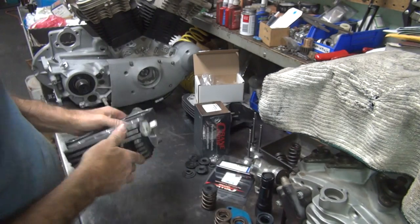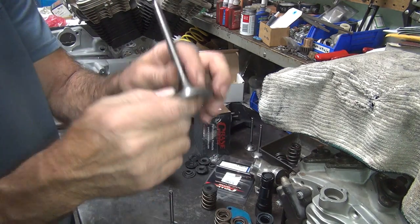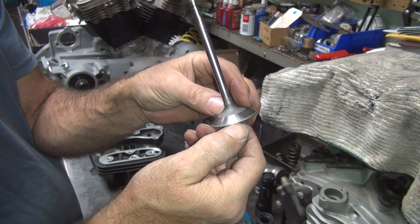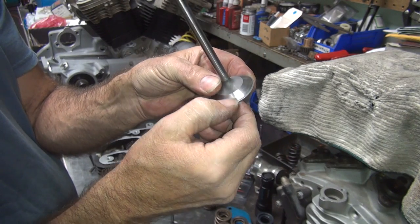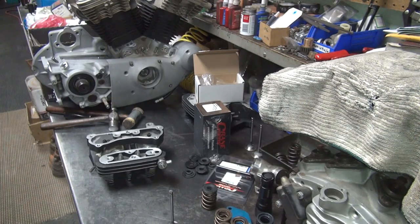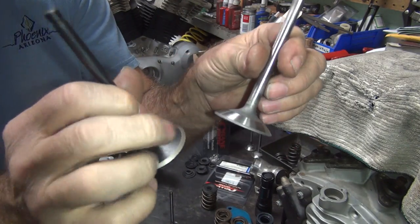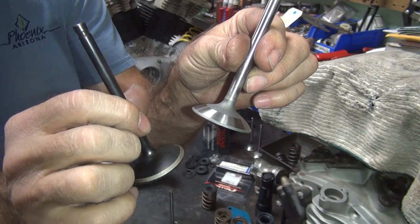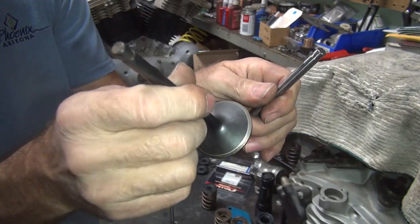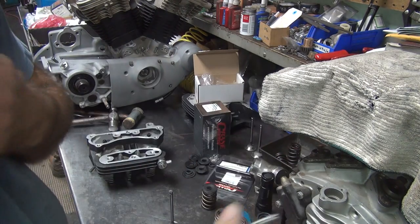So these are the stock valves. I did a three-angle valve job on the valve, so now we have the seat and then one angle and two angles - it's got a nice tapered look to it, like a racing valve would be. This is a performance valve, a Kibble White Black Diamond. You see how they're taper cut real nice. So I make the stock valve look the same way, instead of that real big thick shoulder that they have on stock. It basically makes the stock valve flow like the racing valve - the material is still not as good, but it makes it flow the same.